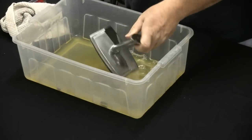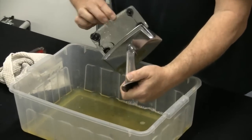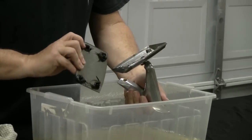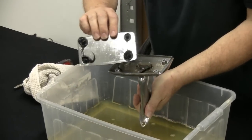Don't be smoking in an enclosed area when you're working on this stuff because you will explode yourself all over the place. Now I'm going to take this out and see if I can get this glass to separate. This is the mirror off of our 64 Falcon. Right away, without even using my screwdriver, I was able to get it to separate. This is basically held on with some rubber and some adhesive at these pin points. I'm going to set this aside, dry it off a little bit, and take this pail of gasoline back outside.